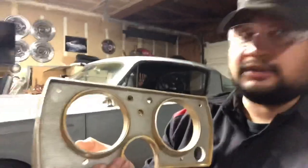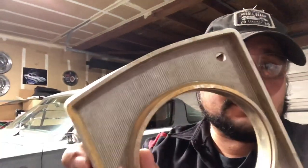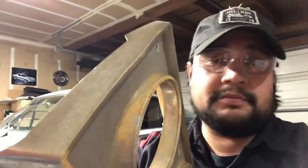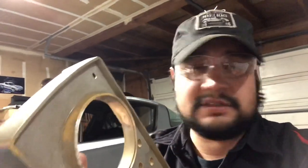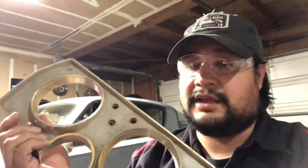This is plastic — old-school plastic — so I have to be very careful with the modifications I'm going to make. The holes in here are way too small to accommodate the gauges I got for this. They don't make ones that'll fit directly. The gauge itself is four and three-quarter inches and this hole is just a little bit more than four inches, so it's just not going to fit. This plastic is really, really brittle — 40 to 50 years old — so it needs to be treated as gingerly as possible.